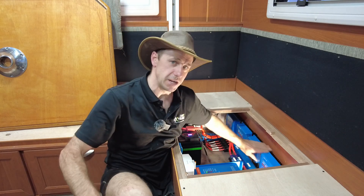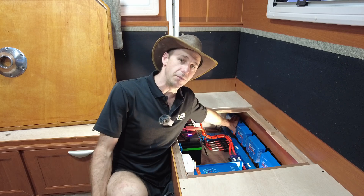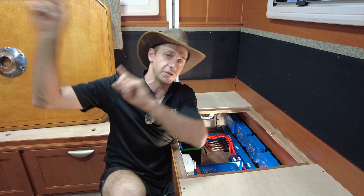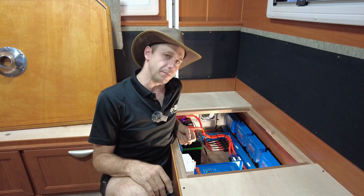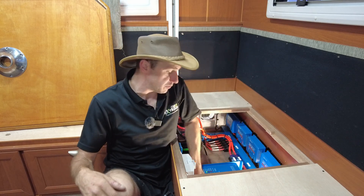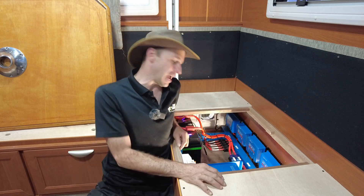So that's the solar chargers taken care of — massive amounts of replenishment power. We've done a Victron Orion 30 DC-to-DC charger back here, which will pump in 30 amps on top of the solar — that's combined charging. And we've got the Victron Multiplus 12/3000/120 amp inverter charger running all the factory outlets, including the ones next to the bed and for the hair dryer in the bathroom.